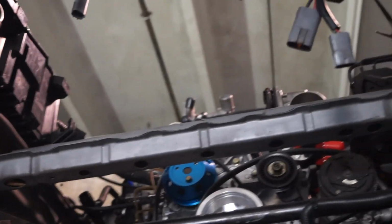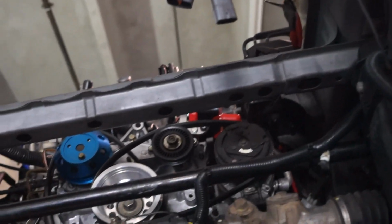I want the least amount of reduction areas and stuff like that. I don't want 5 steps taking this long. If I could just come in clean on one side and just step down once, that's it. I don't want to go from 3.5 to 3 to 3.5 to the flare to 4 again. Just come in 3.5 nice and clean, that's it. Come out however you want. Everything is a smooth transition, no steps.